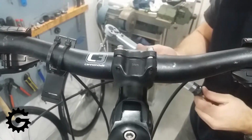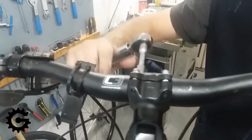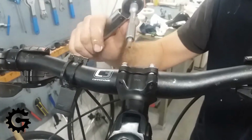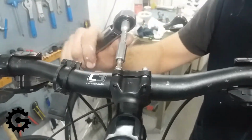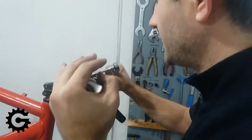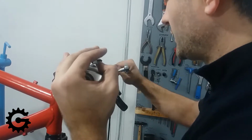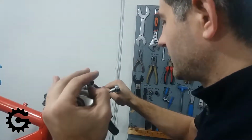There I'm setting it up to the optimal tightening load in Newton meters, and here I'm using again a diagonal pattern of tightening all the bolts, doing it crisscross and gradually creeping up to the optimal tightening force. I don't want to do it all in one go.